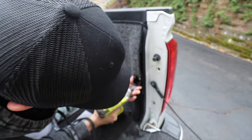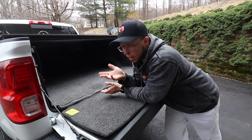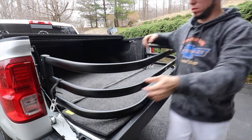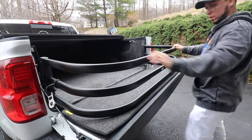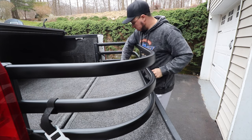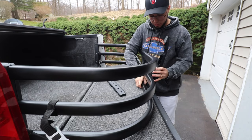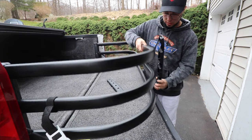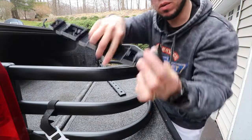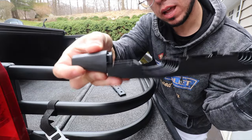Bracket in place — we should just come and attach the extender. With that attached to the brackets it's very straightforward; they attach very easy. You need to install what they call the bumper, but first you need to measure the width of your bed — in my case it's already done. Now if you put this here like this, that's how it should sit. There's a rubber piece and you just slide it in there and that's it.